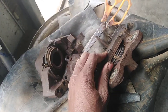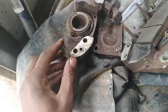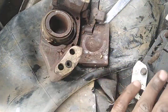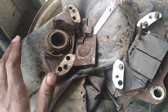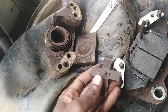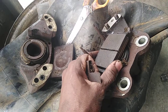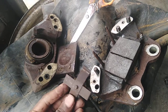I thought maybe it was my brake booster, but it wasn't. I came to find out it was actually these rubber seals right here - this one doesn't have a rubber, so it was leaking. I changed it and put in another one, but found out they didn't have these o-rings either, so it was still leaking. I put the o-rings in and then found out this other thing was blocking my brake pads from moving up and down - from braking and going back to the original position. So I removed it.